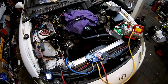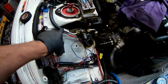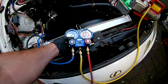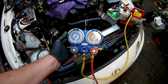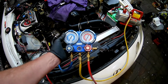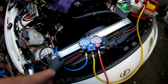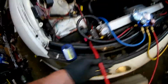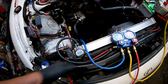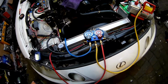If you're going to do this on your own, I know I went through some of how to make the lines before, and the crimping tool. You're going to need to get yourself one of these manifold sets. I got mine off of Amazon. I can likely put a link in the description. One of these lines goes to your high pressure, one goes to your low pressure. It'll be clear which fits where because they're different sizes.